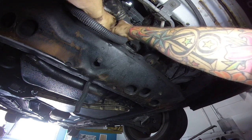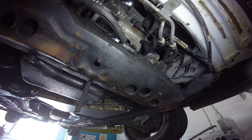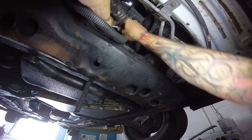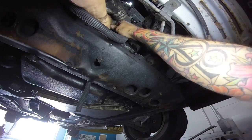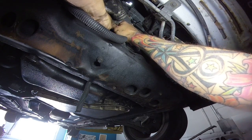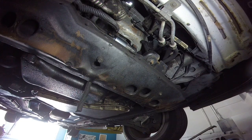I probably didn't cover it because this one had a straight dead battery — it's been sitting in our lot for about 2 months waiting on the customer to get the money up. But you do want to disconnect your ground cable. And if your customer is like this guy and he has multiple batteries in line, you still want to make sure you disconnect the ground on the other one just in case it's grounded in a different spot that you really don't know about, so that it doesn't complete the circuit.